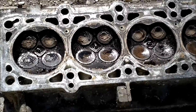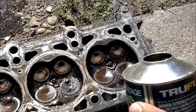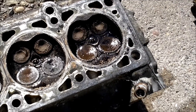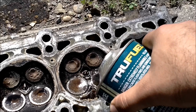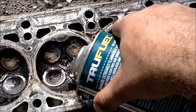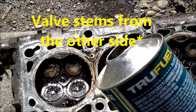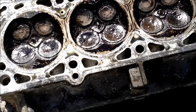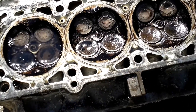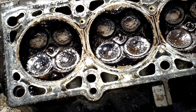I've had previous experience with this. I've got a can of gasoline here — I refilled it from a can I had. You can see just how much quicker the gasoline flows out of the cylinder as opposed to water — even faster than the water does. I really wish one of these wasn't leaking so I could show you this better. I did hit the valves with a hammer and a bolt to make sure they were freed and seated as best they could be, and took the rocker arms off. You can see this one held the water the longest, and it still flows out within a matter of seconds.